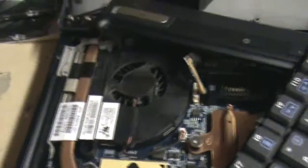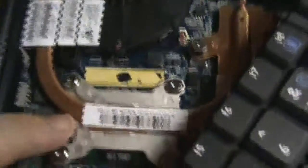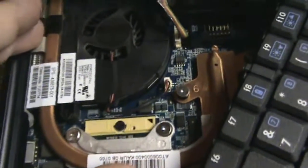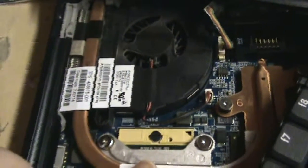There are some snaps here to pull back, and this releases the keyboard. Since we've come this far, we might as well take that extra step of making sure there's no dust caught in the fan, heat sink, and vent area. Here I've exposed the fan, the heat sink vent, and the copper cooling that comes down for the CPU. It blows over the CPU and is shared with the GPU in there. We're going to disconnect this, lift off the fan assembly so we can check for dust and clean it out.